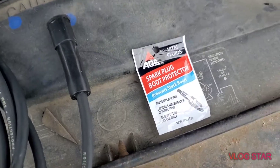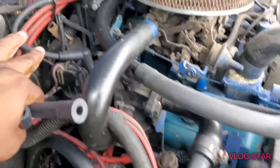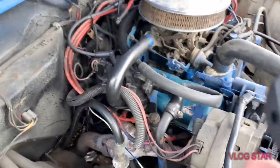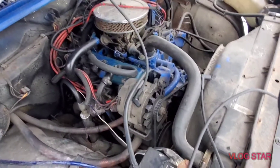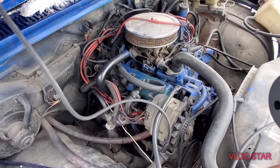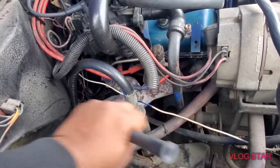If you don't have the lube it ain't really gonna hurt your motor, but when you go to take the plug wires off it might be a little hard. You also typically want to have some spark plug wire pliers, but we ain't doing all that today — all we're doing is changing the plug wires. Got the first black wire on with some lube on there. The next thing to remember: match wire length to destination. This longest wire here goes to the longest distance.